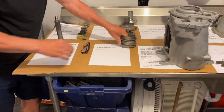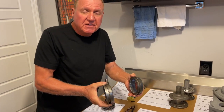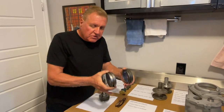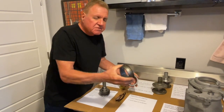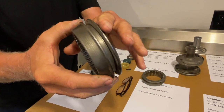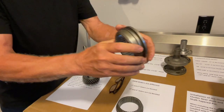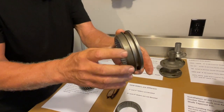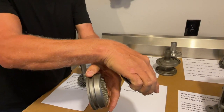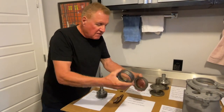A lot of people have confusion about sliders and think they're the same — they aren't. They're different when they are OEM. Replacements and reproductions are all the same, but in an original transmission, this is the slider used for first and second, and if you notice, this side is beveled so it won't hit second gear. This one here is for third and fourth, and it is not beveled. You can see one is thick and one is thin. If you cross these, the car is going to jump out of gear.